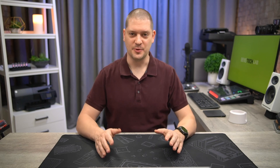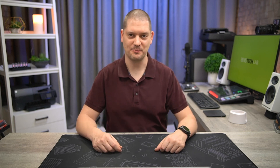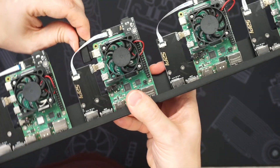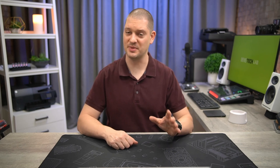Overall, I think this Raspberry Pi rack mount from 52Pi offers great value. The fans on the rack mount are quieter than other Raspberry Pi rack mounts I've reviewed, most likely because they are a slightly larger diameter fan unit. The SD card relocation bracket works great too — after I got the correct orientation of the ribbon cable. I do kind of wish they relocated the Raspberry Pi's USB-C power input though. The way this kit fits together, you either need to buy 90-degree USB-C power cables or buy 5-volt DC power supplies with barrel plugs, neither of which are included. All that said, it'd be hard to find a better Raspberry Pi rack mount for less money, so I still recommend this unit unless you want to increase your budget a fair bit.